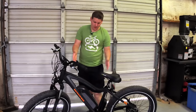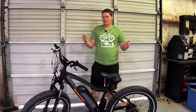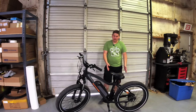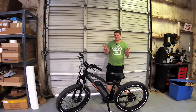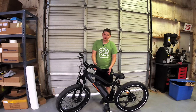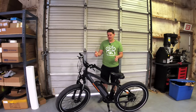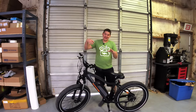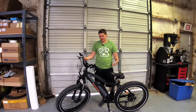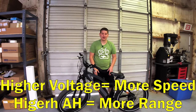So what are the reasons you would want to upgrade the battery in the first place? We have the upgraded controller and display on this bike right now, and that means this bike is capable of way more power than stock. If we use more power, we're going to use more battery. There are two reasons we would want to upgrade the battery. If we go to a bigger voltage, like a 52 volt, which this controller can handle, we can get a little bit more top speed. And if we increase the amp hours or the overall capacity, we can get more range. So not only can we go a little bit faster, but we can go further than what this battery can currently do.